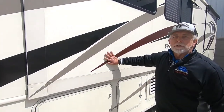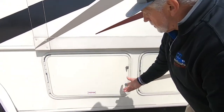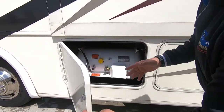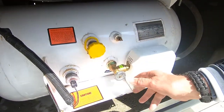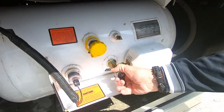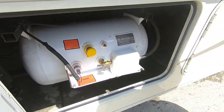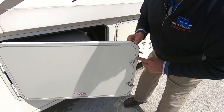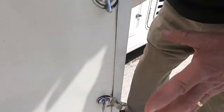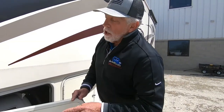I left this slide room in so we can see what's going on down here in all these compartments. This one's labeled propane — you've got your propane tank, your on and off valve right here. You've got a little gauge, and this is where it gets filled when you need a refill. You'll also notice it does not have a lock on this compartment door. State law will not allow you to put a lock on a compartment door where you have the propane.